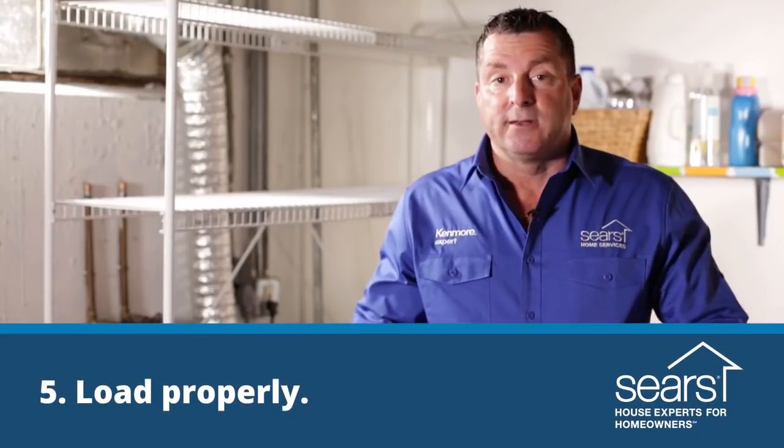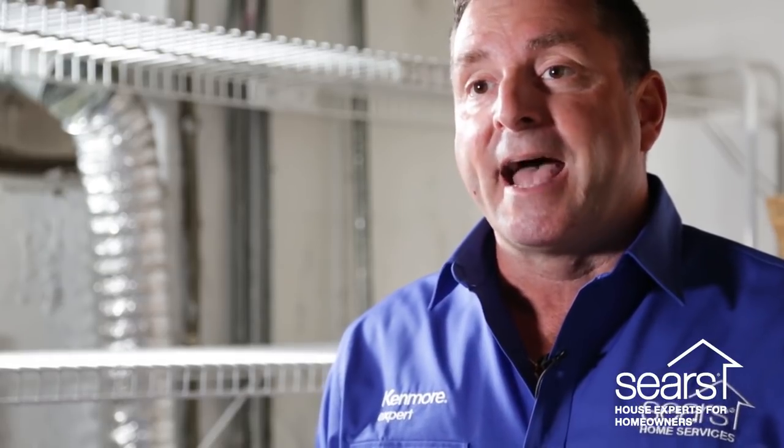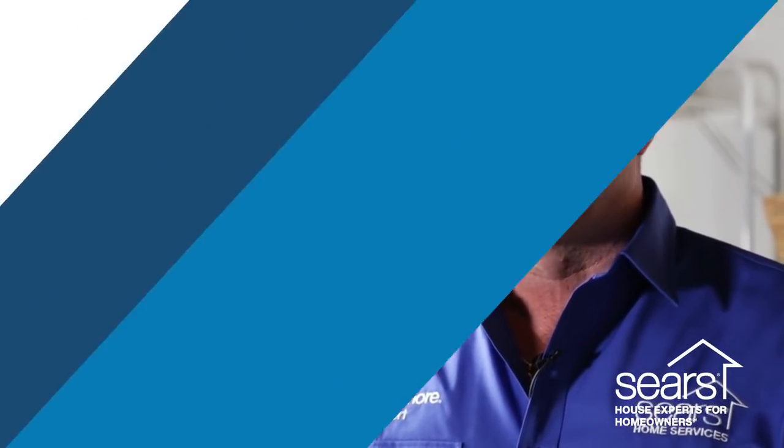Here is a helpful loading tip. Never wash your sheets and blankets with other clothing. The other clothing can get wrapped up in the sheets and blankets, cause your machine to go unbalanced, and actually cause damage to your appliance.